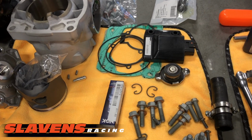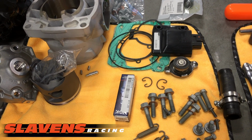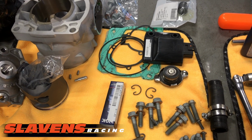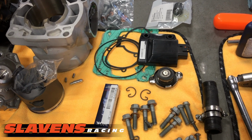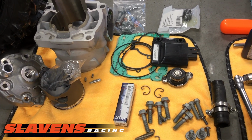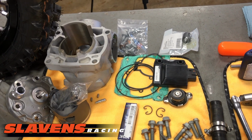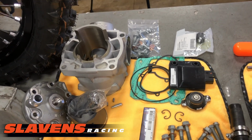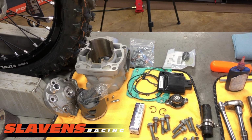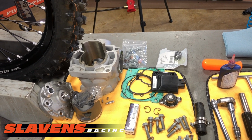And radiator cap. So when you're draining the fluid, I take my bikes outside to do this. I don't care how careful I am, I always end up splattering that stuff on the floor, the hoist or whatever, and I hate antifreeze. It's a sticky mess. So I always drain the coolant outside first into a pan and then properly recycle it. Don't pour it down the drain. That's a bad idea.